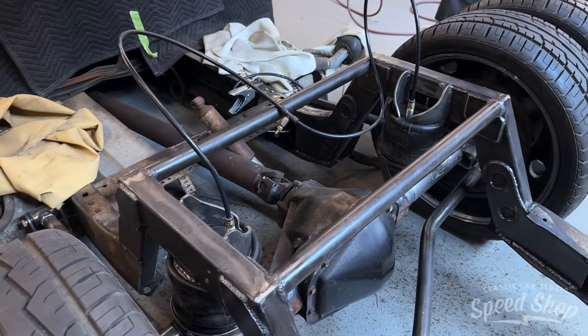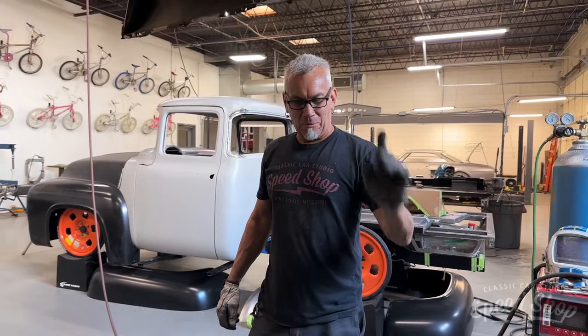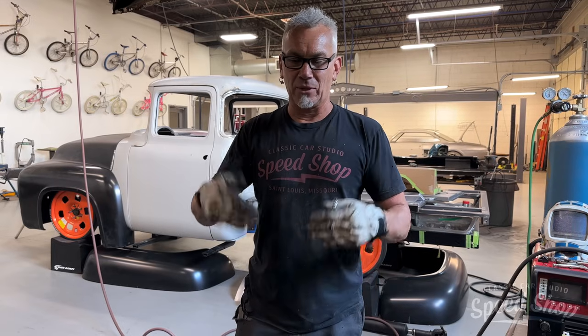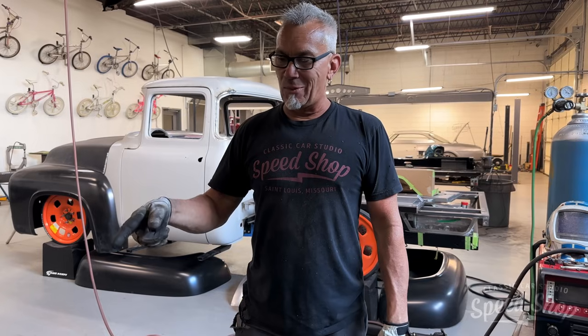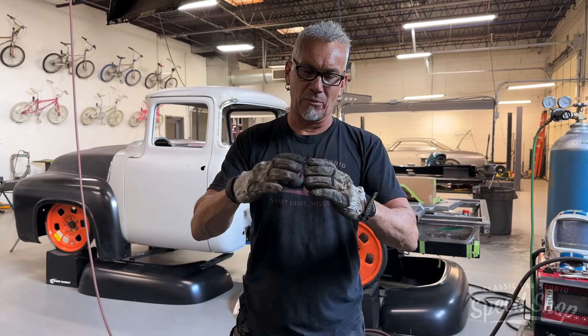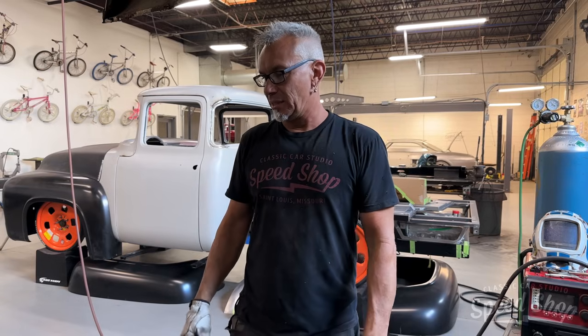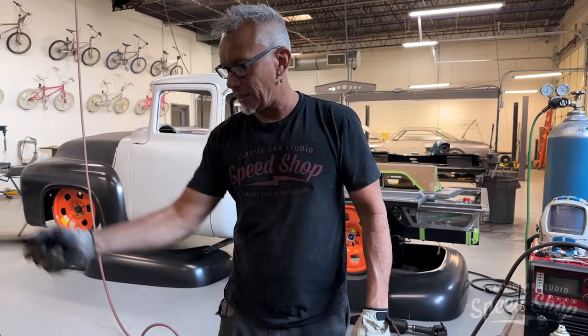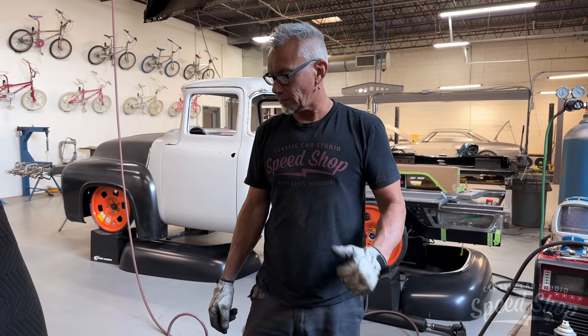Next weekend's agenda: mount the gas tank, paint all of this, put it all back together, and start mounting all the AccuAir ride level sensors. It's going to have full sensor air ride on it. I'll have to mount the sensors to the four-link bar or the rear end to measure travel front and rear. We've got to come up with tank mounts and mount all the computer stuff. The computer's actually pretty cool — it's backlit with the little AccuAir symbol. I'm going to put it up inside the bed and try to make the metalwork come around it. It'll light up at night, it's waterproof. Probably hide the tanks and pumps where the gas tank is now. Shit changes by the minute, but that's where we're at.